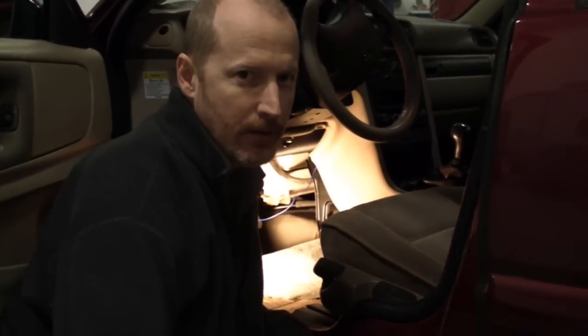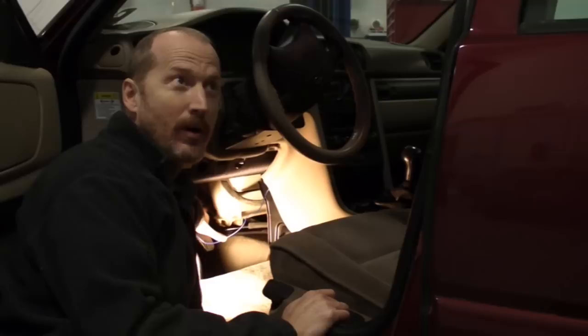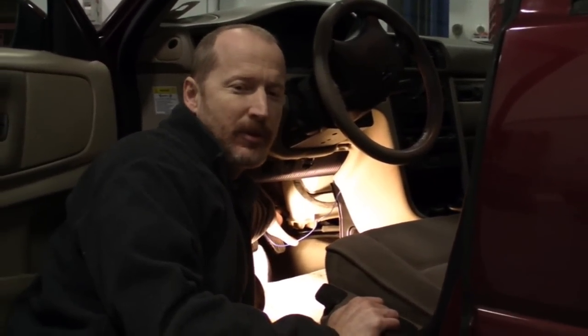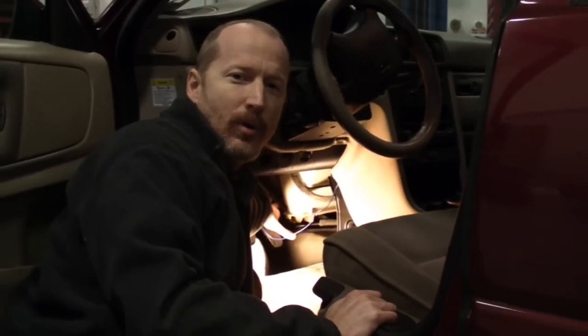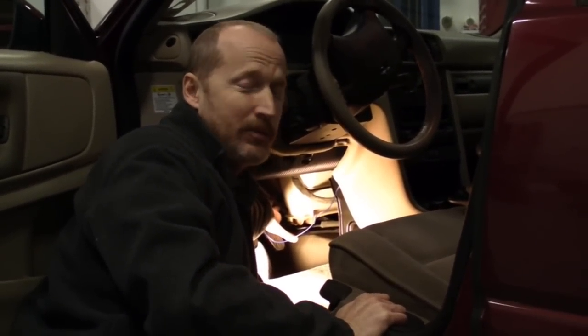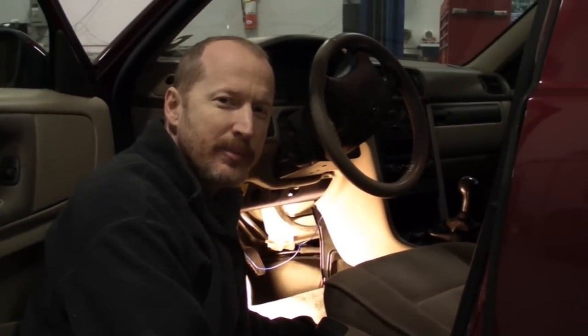One thing worth noting, early 850 models, the pipes that lead to the heater core are made of steel, and they have a big problem with corrosion. I know a lot of people have gone to the wrecking yard and bought heater core pipes from a later car to put in to fix their rusty pipes, because the later ones are aluminum. So let's move over to the other side of the car and see how that comes apart.